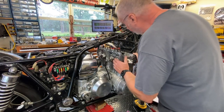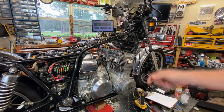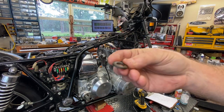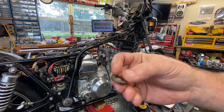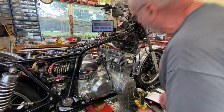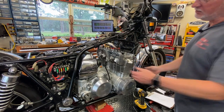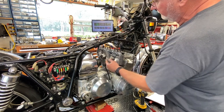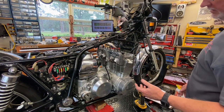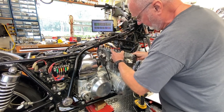All the fasteners are out. These steel washers are the biggest pain on these — just about every bike has them. Kawasaki's have a sealing washer on the outside ones made of copper because of the oil passage, but on this bike they're like this and they always stick to the head, especially the inside ones. Get these out because if you try to slide the head up the studs they'll cock a little bit and grab. The service manual shows you can start tapping, using the studs that extend down through the cylinder block. It also shows three reinforced pry points on the front, but I always go off the adage: try before you pry. And you can see it's already moving.